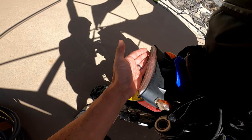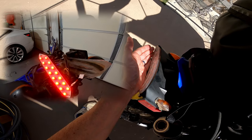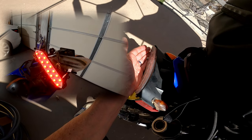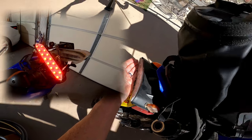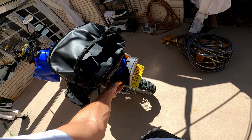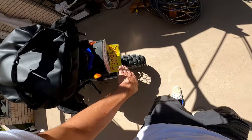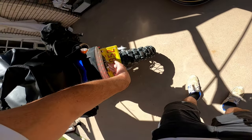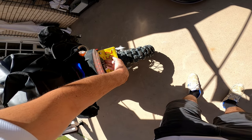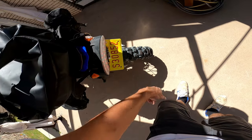The wire leading to the rear brake light was broken, so I repaired that — just soldered it back up. The rear turn signals — the stock ones were broken, so I replaced them with Tusk low-profile turn signals that I had lying around. The rear license plate light was missing, so I bought some 12-volt LEDs off eBay, and at night it's pretty bright — the plate is very clear.